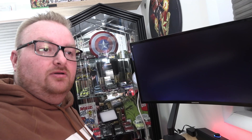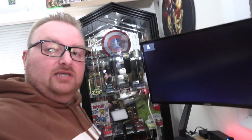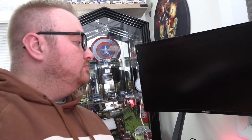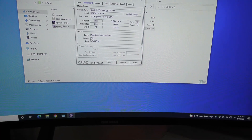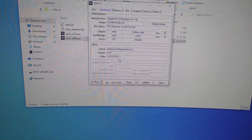At this point I'm going to hold the power button and force shut it down. When it powers off — there it goes — give it a second and we're going to power back up. We should be good. It's a good sign — and look at that, we're getting into Windows. Let's take a look at our BIOS version in CPU-Z and make sure it updated. We have F14 — so it did update. It's not F14D anymore, and you can see the BIOS date version right here.